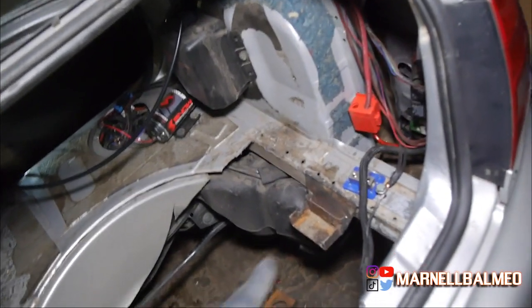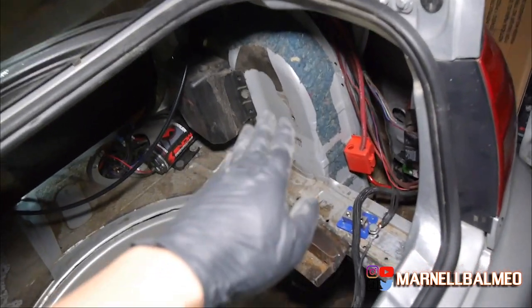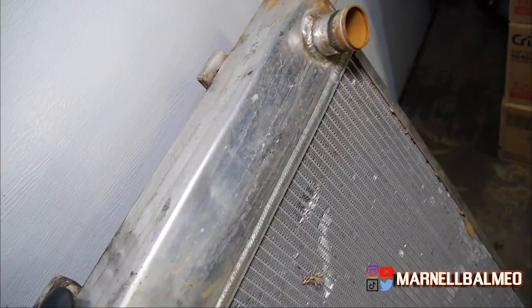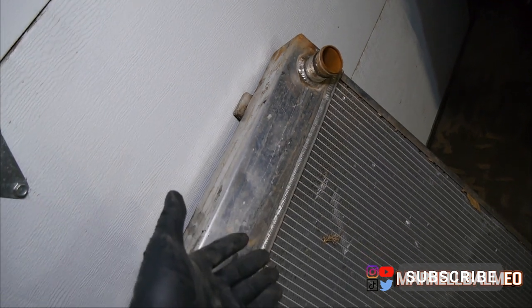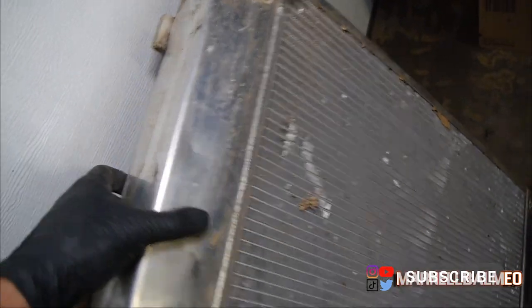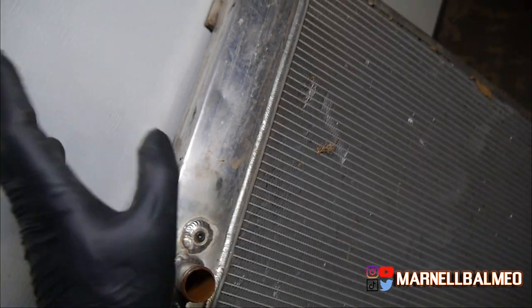Installation-wise, it looks like I didn't do a good job because it was hard-mounted with a little bit of bushing or rubber, and same thing for the top — there was a crossbar and it looks like it kind of got compressed a little bit. I mean, it could also be from overheating, or it could just be poor materials. Either way, this still needs to be welded, which I'm surprised they didn't do — they just did a double tack on both sides, and I guess that's supposed to keep the majority of the fluid going around the full path.